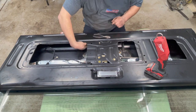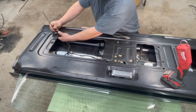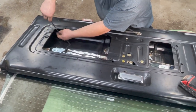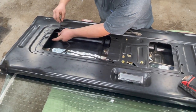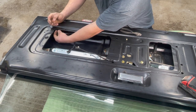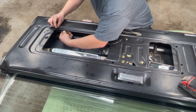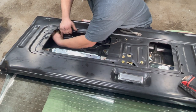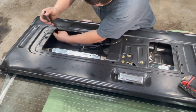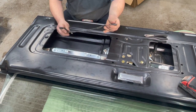On this side of that same harness I'm going to put another clip over here to make sure the wires stay up and away from the glass as it slides up and down. Do the same thing — push it up, make sure the wire is nice and tight so it's not hanging down to get caught, tighten it up, and trim the excess.